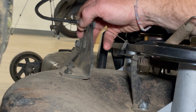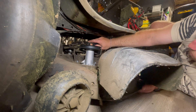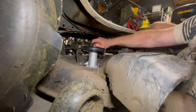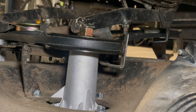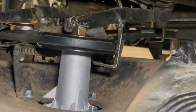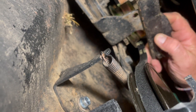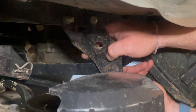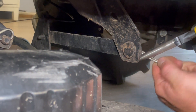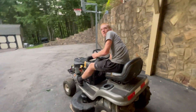Here we are with the engagement cable — that's what pulls the idler pulley into place and puts tension on the blade, engaging the blades. Here we are installing the links that lift and lower the deck; when you pull the lever, these guys pull up. This deck is a lot more difficult than other riding lawnmowers like Cub Cadets — a lot of little pins, a lot of little links. All in all, looks like there's a total of five links: two front sways, two in the middle for lifting, and a rear one for stability. Once we get it in, it's ready to roll.